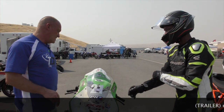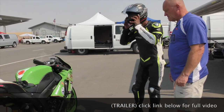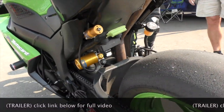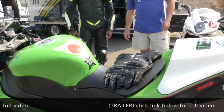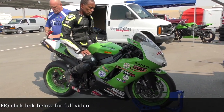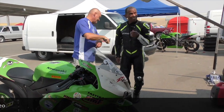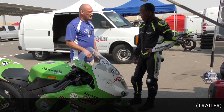The next thing for me to do is ask why your forks are in this position. Especially in regards to chatter, if the front end is too low in terms of fork placement, there's a potential issue there. Sagging the front is correct as a starting point, because the carcass flexes a huge amount, which can all by itself create chatter.